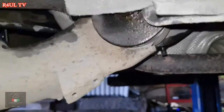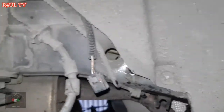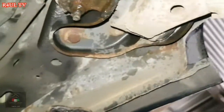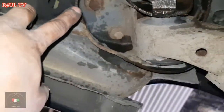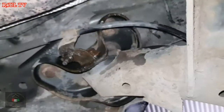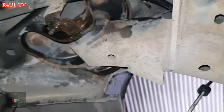In order to get that down nice and safe, take the ABS sensor wire off so when it does come down it doesn't rip the wire off. We're going to do one side at a time — take the shocker bolt off, and there are three bolts holding that bracket: one, two, three. Take that off and the middle one also holds the bushing.